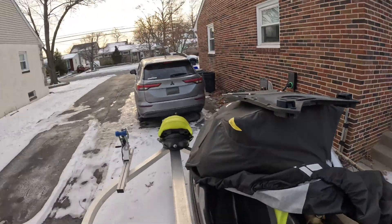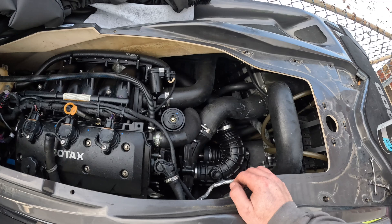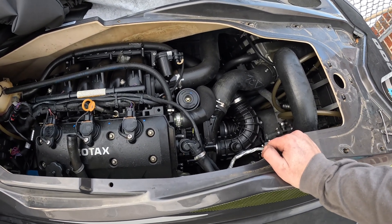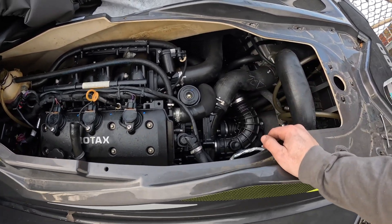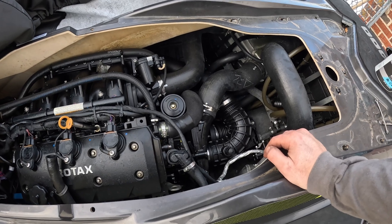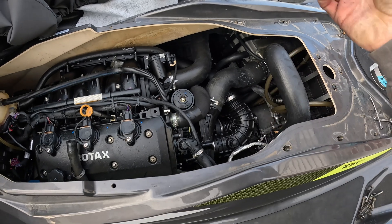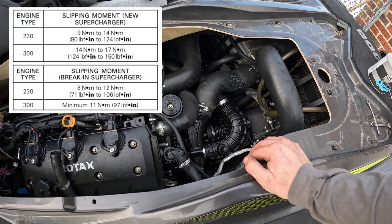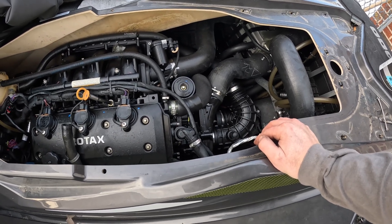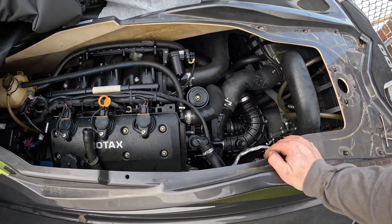It's a really bad day for this - it's probably 17 degrees right now. You do not need to check the slip on these superchargers until 200 hours, so he can go another 100 hours if he wanted to. But I'm going to do it anyway. When you check the slip, Seadoo has a specification. For the 230 post-break-in, the supercharger slip moment is between 8 and 12 newton meters.